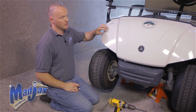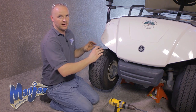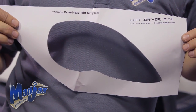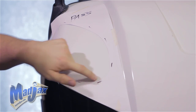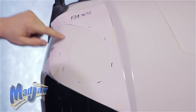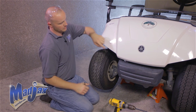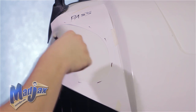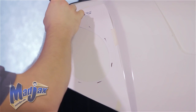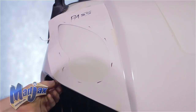To begin, we're going to cut the hole out for our passenger side headlight. The template for the headlight comes with a print labeled driver side only — flip it over for your passenger side. It should look like this: the curve pointing towards the bottom of the cart, a teardrop shape pointing towards your front strut. We've taped it on the inside of this channel, with the bottom side hugging the bottom of your cowl. Take a pencil and trace out the inside of the template.